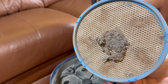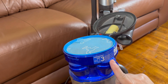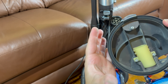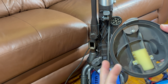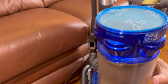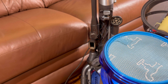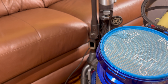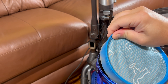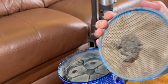Look at that — this is a little over three months' worth, for sure. You can see the dust down in there. But more importantly, the air is flowing up through here and this filter is filtering. Look at this — there is just dusty muck in there. That is nasty. That's getting past the filter, which means the cyclonic action is getting the stuff you can see. But this filter, because they're washable filters, is not as good as a true HEPA filter. Even if some of these are technically called HEPA, if it's washable, it's not filtering at HEPA standards. This can only filter so many microns, and enough of that dust is getting through — even through the cyclonic action — to accumulate in the filter.